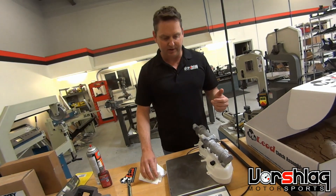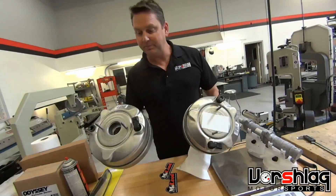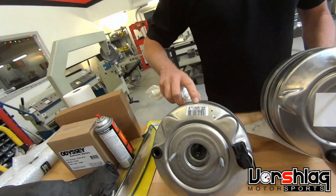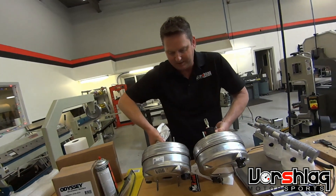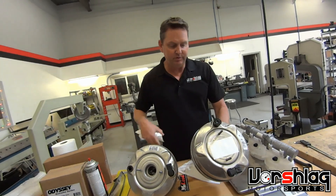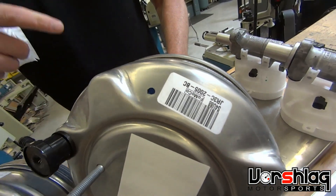The booster is also different, and I'll show that next. Here we have the two brake boosters. This is the base GT brake booster. This is your part number here, this JR3C number. So this is what came on the car — functionally it looks the same physically, but apparently it's a very different level of boost. And here's the part number on the performance pack booster, so we're going to change that as well.